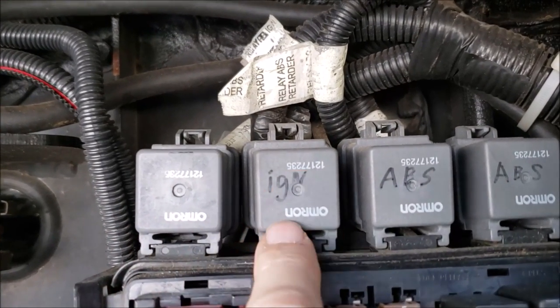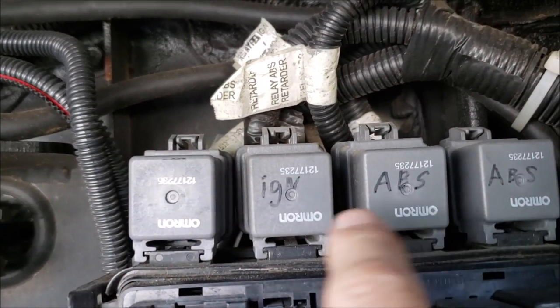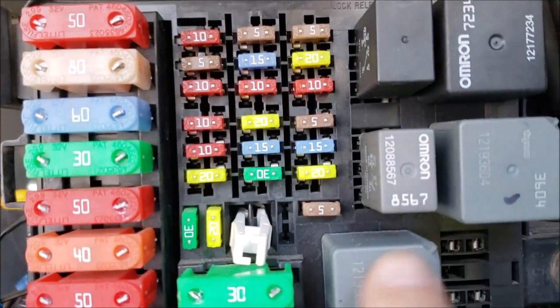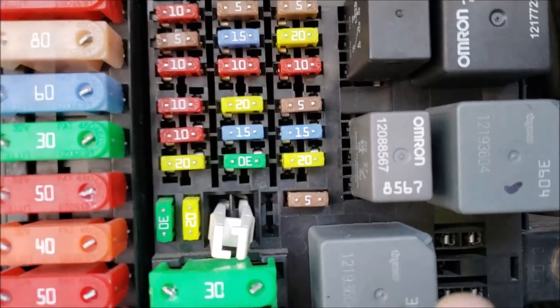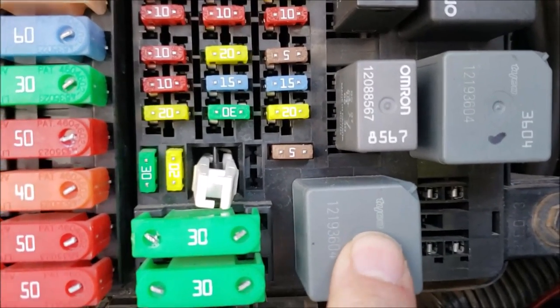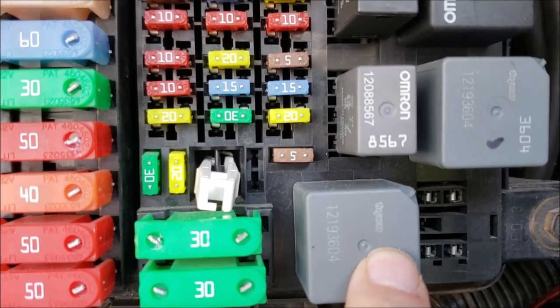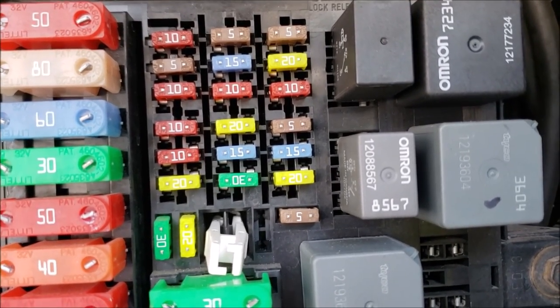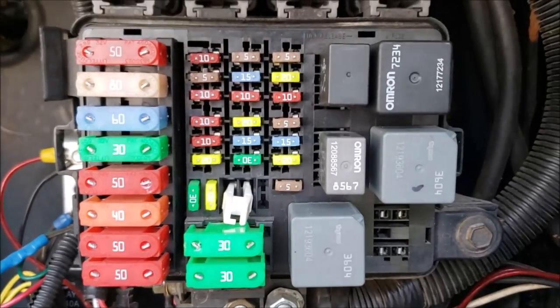That's why, with the age of these vehicles, we need to get these stocked up. All four across the top are the same part number — covering the auto brake, ignition, and ABS. I keep a couple of spares of this part number. I'm going to take you inside to show you how to cross-reference these things, because I've got myself stocked up pretty well now.